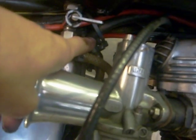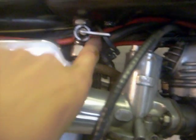So there's a short one. That's the one from the bottom of the tank to the feed side of the pump, and then the other side of the pump is this one here, which goes up to the return pipe. Half returns to the tank and the other half goes up to feed the rockers through these pipes. So I'm changing this feed pipe, return pipe and the feed pipe.